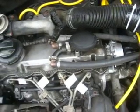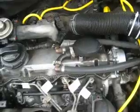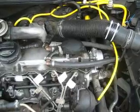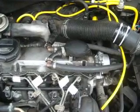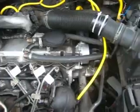The canister device is made to separate the oil and only let through the gases. That's what a PCV valve is supposed to do — it's not supposed to let through a lot of oil. But apparently on TDIs what happens is we get a lot of oil that shoots down, gets stuck in the intercooler, and then starts to combine through the EGR and cakes up your intake. We all know about the caked up intakes.